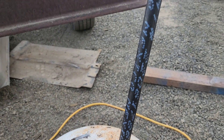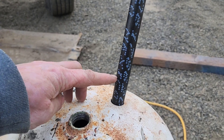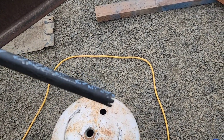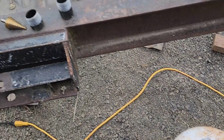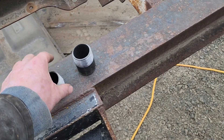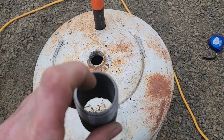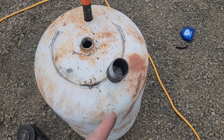We've got to cut this to length so that just a little bit of thread comes out the top, and we know it's going all the way down to the bottom. I cut the smaller pipe down and put a bunch of slices into the end so that even sitting up against the bottom, it's going to be able to suck fuel. Now this other pipe I cut off a little bit uneven so a piece can sit down on it pretty well. I'm going to step-drill this out to an inch and a quarter, which is the inside diameter, and then I can weld around it - that'll be my filler neck.